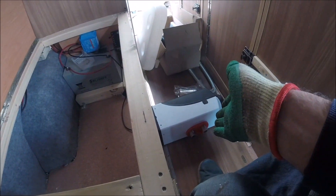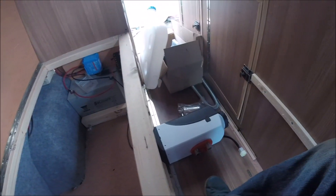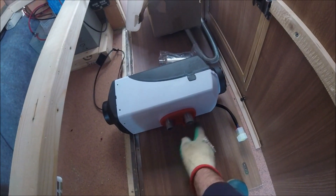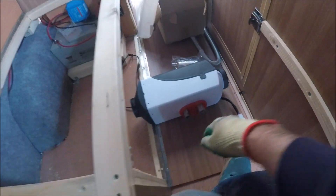Obviously if you had any of those pipes coming inside the van, that's basically just a surefire way to kill yourself with carbon monoxide poisoning - I want to avoid that as much as possible. So we're going to be fitting the heater under the bed. I need to cut pretty much the same size hole as the rubber underneath, so I'll use that as a template for drawing around and cutting out.